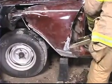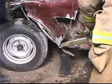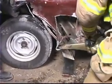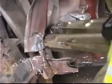Force the bottom of the fender away from its attachment point, exposing the remainder of the A-post. Weaken the A-post by making additional cuts. On newer vehicles, these additional cuts may be required due to high strength materials.